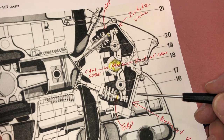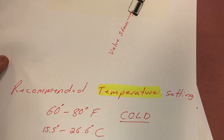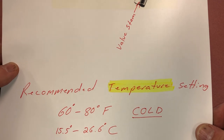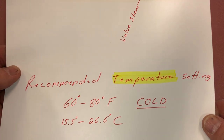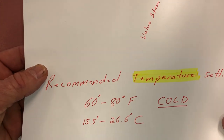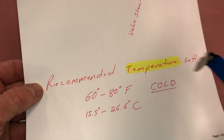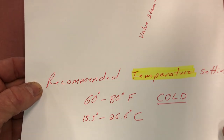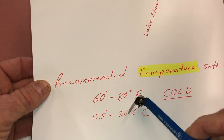For now, let's talk about valve clearance at the top — our valve lash. One of the things we need to be concerned about when setting valve lash, particularly on these cars, is that some specs are set to be done at operating temperature. But in the case of this engine, it's really recommended cold. The best temperature range to set this and get the most accurate reading is within a specific range. Extremely hot or extremely cold weather — I wouldn't recommend doing it, because the degree of variation is so small you could actually affect your adjustment. So temperature range is really important to setting your rocker.